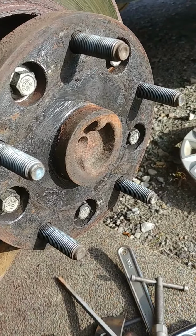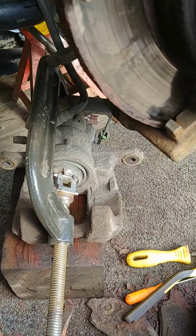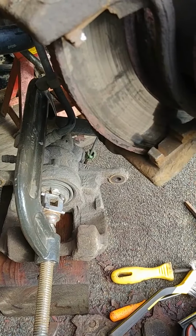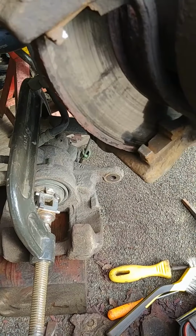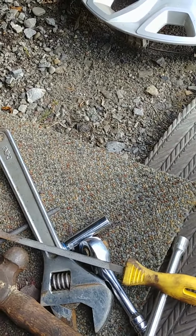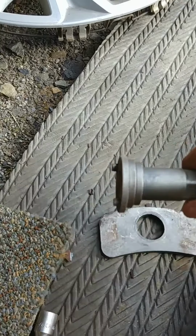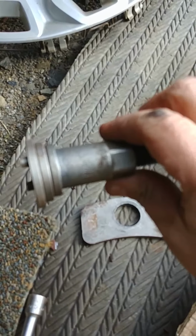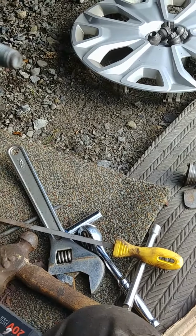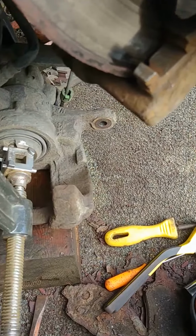I have a 2016 Ford Transit T350, and like a lot of people that are probably looking up caliper issues, rewinding the passenger side rear caliper in a left-hand direction can be challenging if you don't have the proper tool. Now, I went and bought myself one of these tools, and although it works great for the right-hand side, because this is a right-handed thread, on the left side, you have to wind that caliper counterclockwise, and it can be really difficult.